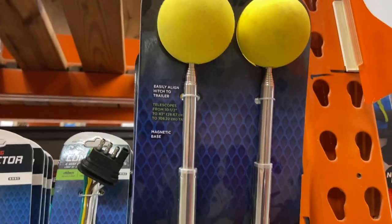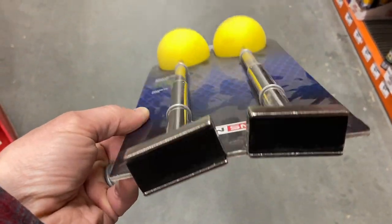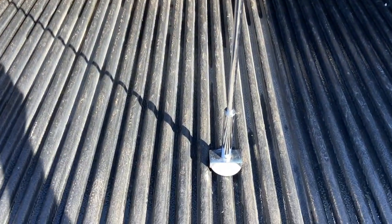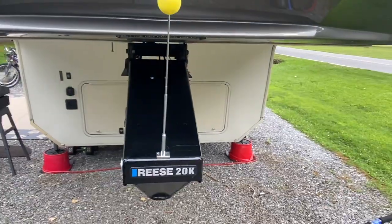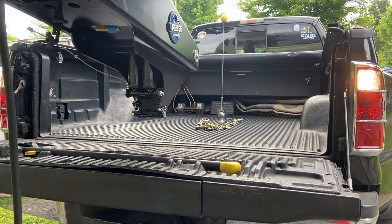One of the last things you can find at Home Depot is all sorts of tow gear. If you're looking for balls and hitches, you probably already have that. But one neat little item I stumbled across is these little tennis balls. These are great any time you need to hitch up — it's essential if you have a Reese Goose box like I do and you're gooseneck towing, because you can't see that ball down in the bed of your truck. I line up, and when the Reese Goose box hits the tennis ball and knocks it over, I know I'm right over that ball. These will help anybody hook up, especially if you're towing with a travel trailer, and will even help line up if you can't see your fifth wheel hitch due to a high toolbox. They're cheap and I find them extremely useful when backing up and hitching up.